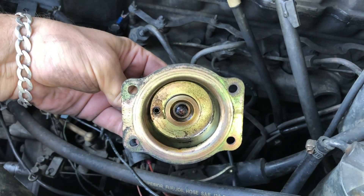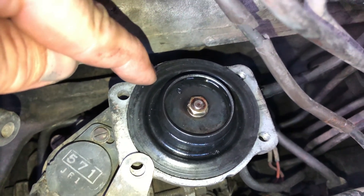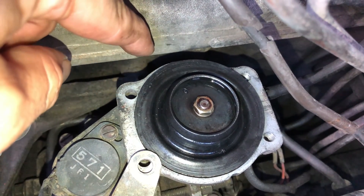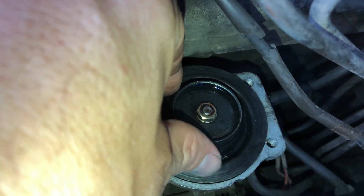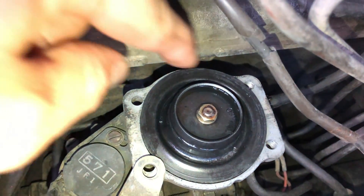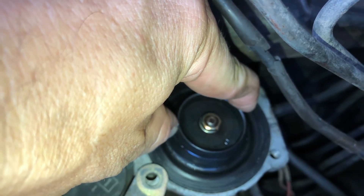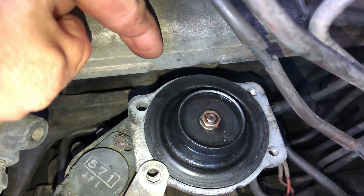That's what the underside looks like. Here's the original position of the compensator diaphragm. You can see that the O is not exactly towards the engine block — it's slightly counterclockwise. So 90 degrees would be right about there, and I had it at about here. So actually I had it about 180 degrees off.